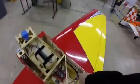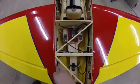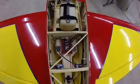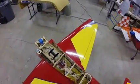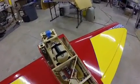When you look in here, you can see this is where I was talking about. You've got incidence pins right back here on both sides. I've got them wire zip tied to them because I don't adjust them. Anyway, what you end up doing is putting a plate over this. They're a hardwood plate that I have custom made for each side, front and back, and then a nylon screw, basically a nylon bolt. Well, that's the bolt. It's a wing nut. Anyway, so that happens there, and what it does is it spreads the weight out onto the plywood of the aircraft and makes the wing stay on nice and strong.